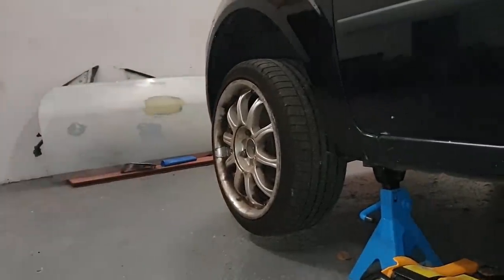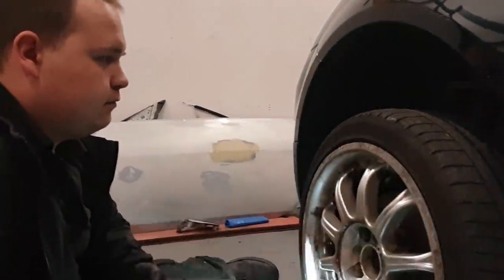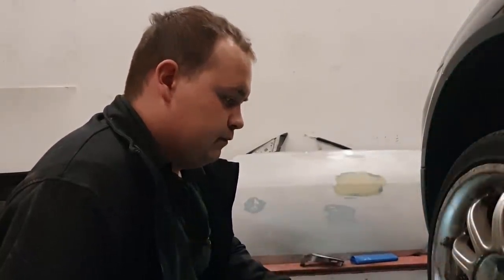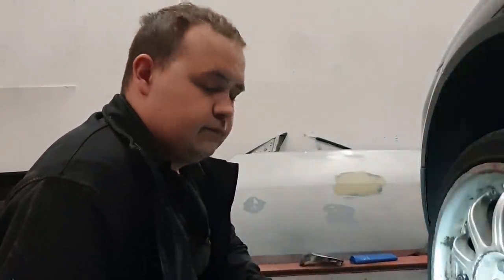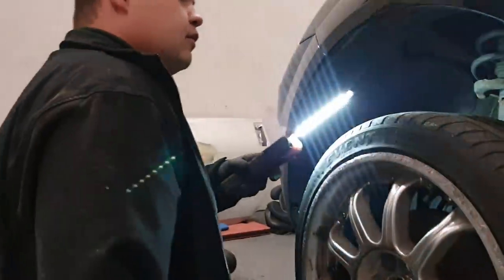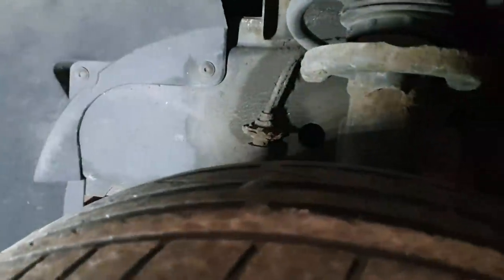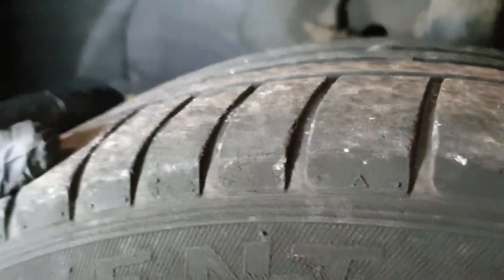The first mechanical thing to check is your tires — very important. The minimum tread depth is 1.6 millimetres; anything above 1.6 mm is accepted, but you really want to be well above that. The tread is checked across the central three-quarters of the tire — roughly a thumb's width inwards from the edge.